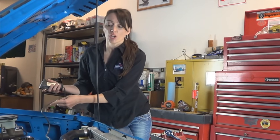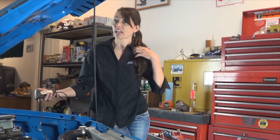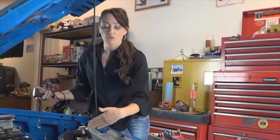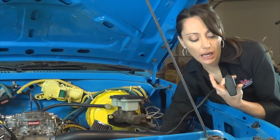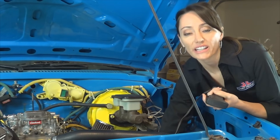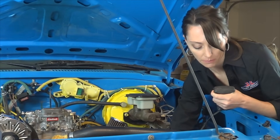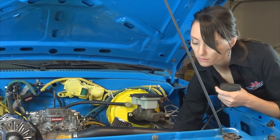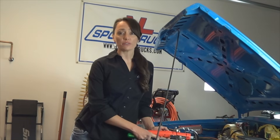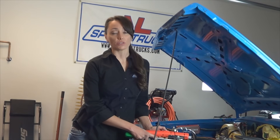For the second step, make sure that your remote starter wire is out of the way, any clothing is out of the way, and if you have long hair, make sure that is out of the way of any moving parts of the engine. With my left hand, I'm going to hold the remote starter, and with my right hand, I'm going to put a finger over the spark plug cavity so I can feel the compression when I rotate the engine. I'm going to do little taps so I can feel the compression — and there's a good one right there. Once you've felt the compression from turning your engine over, you're going to need to align your mark on your harmonic balancer to the zero on your timing cover. As you can see here, we've aligned ours.